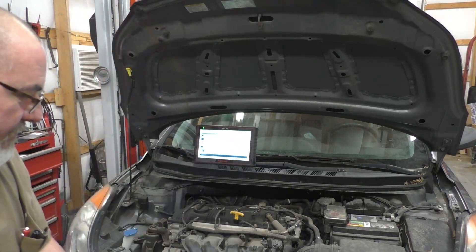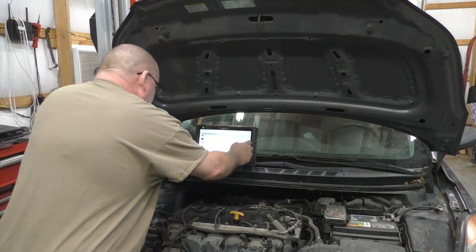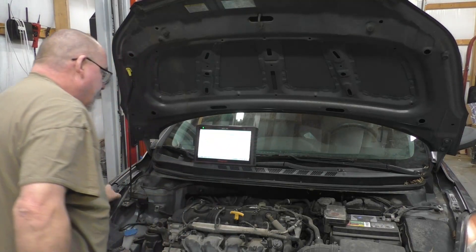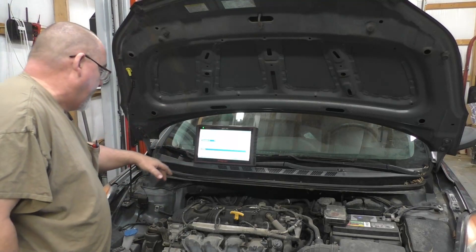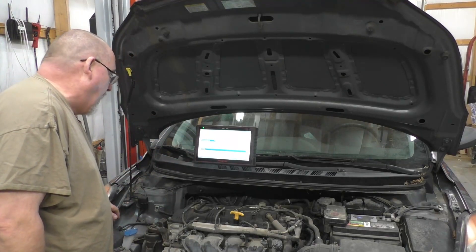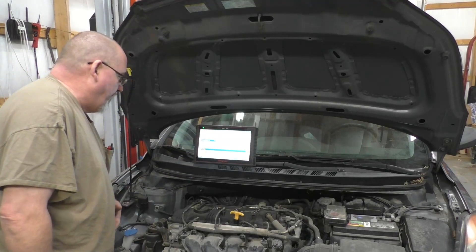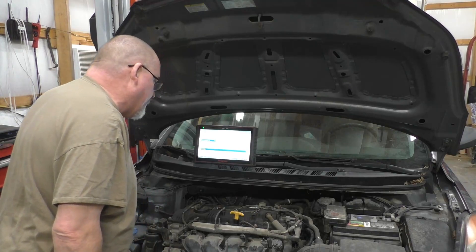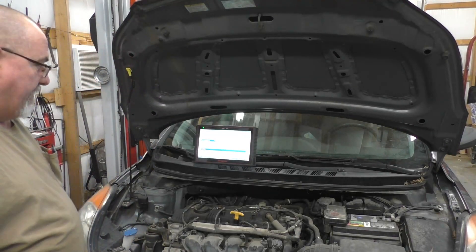Let's see what the tool says, let's see what we got here. I've literally never seen that — didn't find any related bulletin. Okay, I see what that's doing. Top repair for P0335 is replace the crankshaft position sensor — we've done this like 1,500 times.